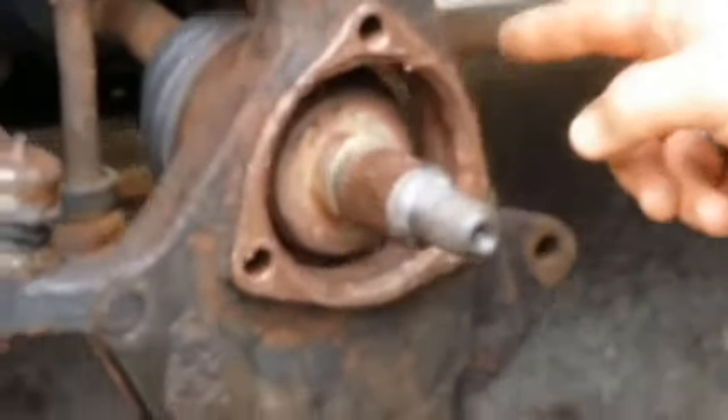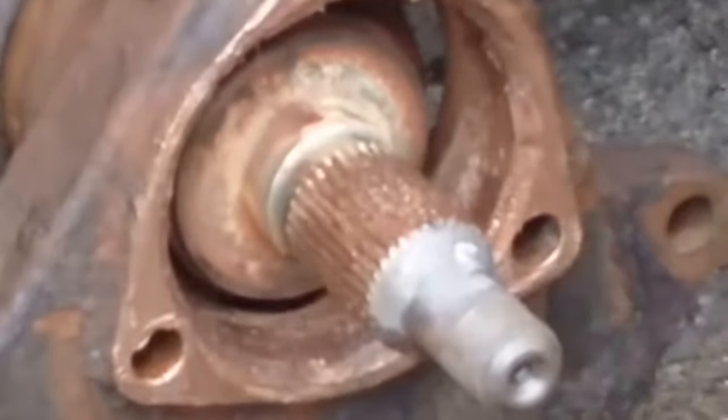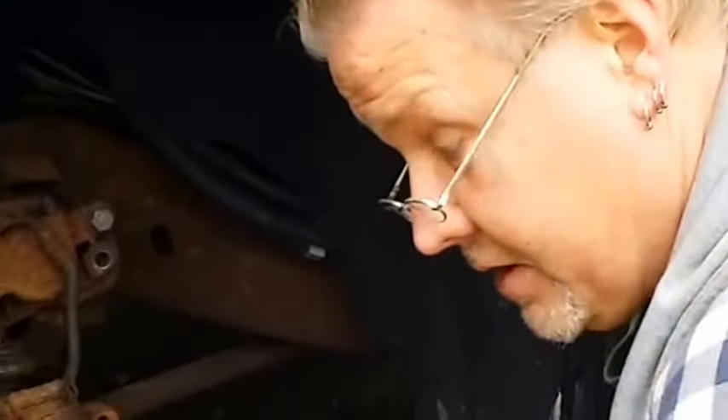What I did here, just to prepare this and save a bunch of headaches for the future, is I used some copper never-seize anti-seize compound on the splines and on the CV shaft as well. It'll just make it a lot easier if I have to change a wheel hub. A neighbor told me once you replace wheel hubs they're never going to be the same and they all go bad quick — that's not true. What it is, is people are buying cheap parts or they're not torquing down the hub assembly to the proper spec.